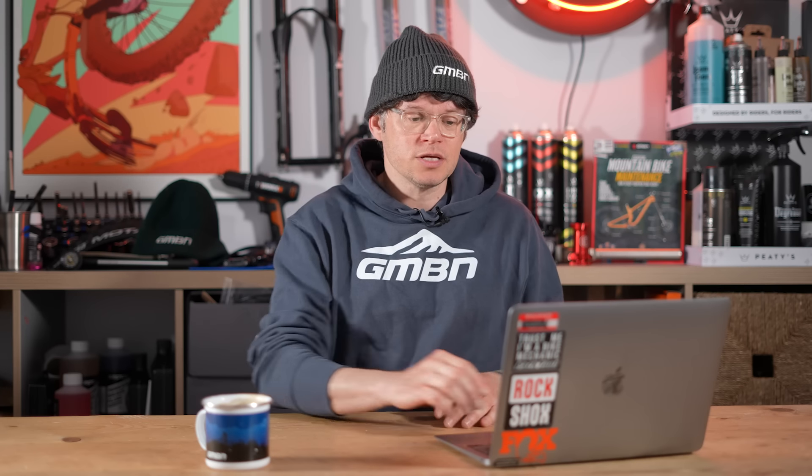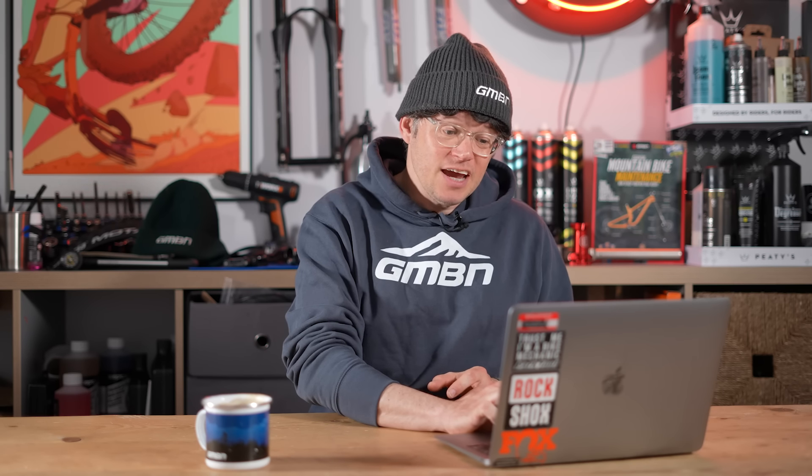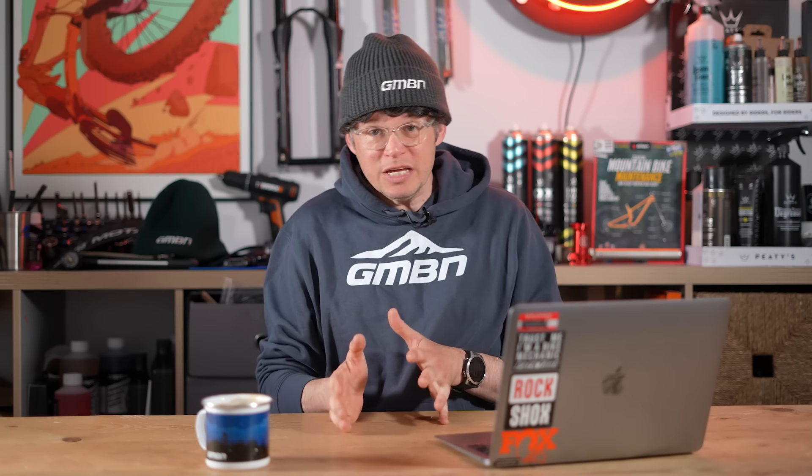Options time. It's trickier, especially when you're trying to source a 26-inch fork. A suggestion from TF Tuned: hunt for older forks of the same model — hopefully find a couple, maybe up to four — pull them together and create one fork that works. You could also search for new old stock from Fox or RockShox, where you've got more chance of getting service kits because they made far more of those forks. Shopping around for a brand new fork is probably the best other option — RockShox does a Recon 26-inch, though the drawback is it has a tapered steerer.